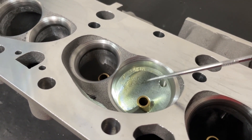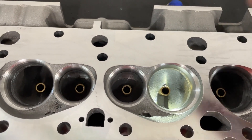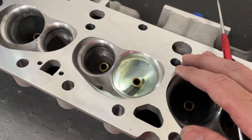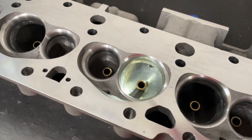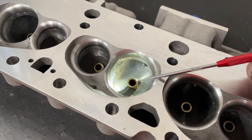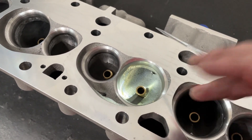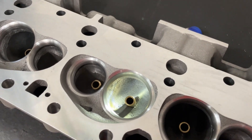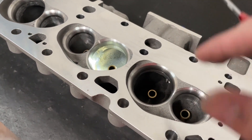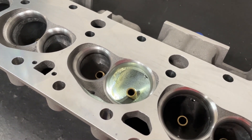I do plan to port these — I've got one head done, and this one I'm just going to use for this test. Now, Profiler used to be the best bang-for-the-buck head, period, because they flowed relatively close to what an AFR head flowed, and AFR is fully CNC ported, but Profiler was like $600 cheaper. Well, that's out the window now. This 210cc head versus the Brodix Dragon Slayer with CNC chamber, bowl blend, and gasket match is within $50 of each other depending on where you buy.